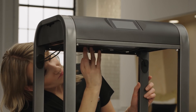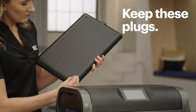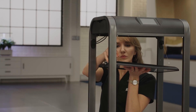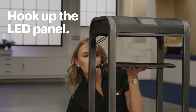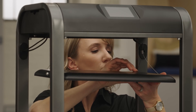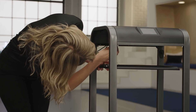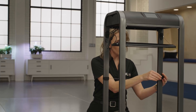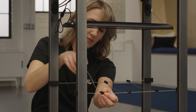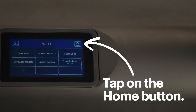Now, if the light cords are attached to the top, you can take them off for now. Take off the rubber plugs from the LED panel, but make sure you don't throw them away — you'll need them in just a bit. Insert the metal endings from the light cords into the openings on the top of the LED panel. Make sure the power port on the LED panel is on the left side when connecting to the light cords. Put the rubber plugs back into the holes to secure the light cords to the LED panel, then connect the LED panel to the plug in the top of the unit. If you want to use the trellis cords, attach the magnetic ends to the inside of the metal frames, and then install the cords that go across — these are really great for taller plants. Now plug it in. When the screen comes on, tap on the Home button. There you go!